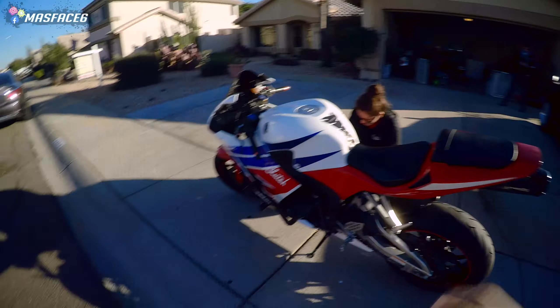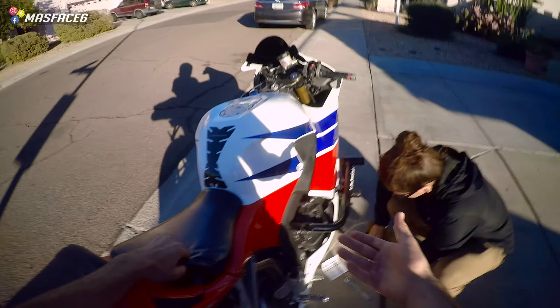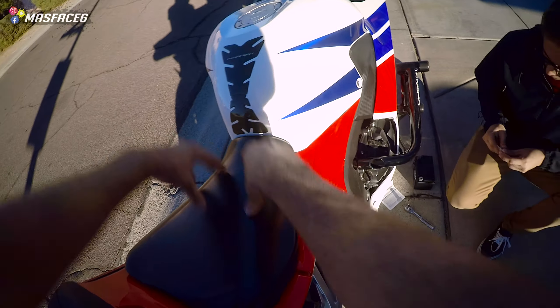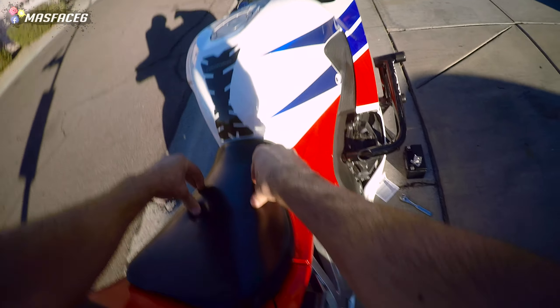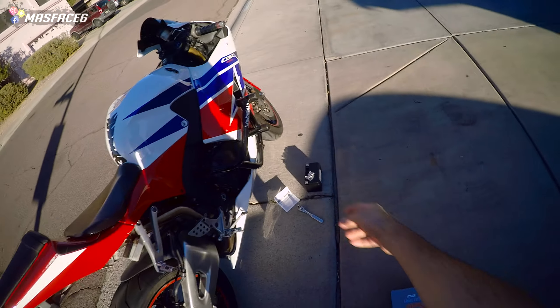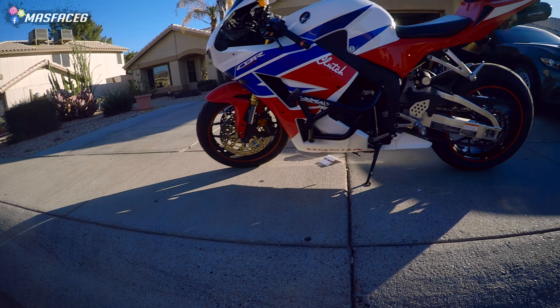You pretty much just need — what size is that? A 10mm? 10mm, again for this specific bike. We're going to remove the seat because the battery is sitting under here. Once that's off, there's really going to probably be a bracket with most likely the same exact size bolts holding that in. We're going to unscrew that, remove the bracket, and the battery is going to pop out. Then we're going to put the new battery in — and really, that's pretty much it. So we're just going to show you guys how it works step by step, and you guys will be able to do it by yourself after the video is done. Let's get into it.